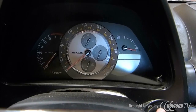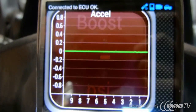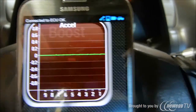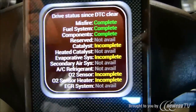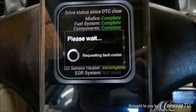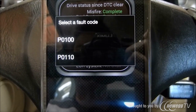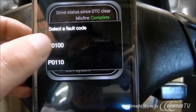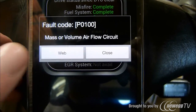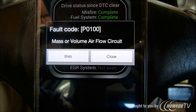We'll go ahead and shut off the vehicle and turn the ignition back on. I'll scroll back to the main page on the phone just to make sure the ECU is connected, because every time you shut off the vehicle it disconnects and sometimes takes a few seconds to reconnect. Now we can go back to this screen, go ahead to Settings, take an action, and show logged faults. We have two faults — click on one of them. It automatically tells you that it's a mass or volume airflow circuit. If you click on the web button, it'll actually take you onto Google and give you a little bit more information about the code to allow you to get a better idea of what the situation is.